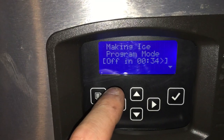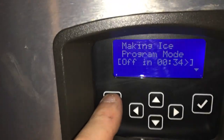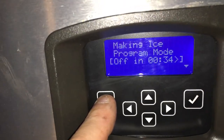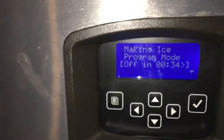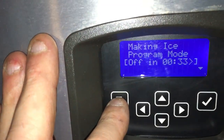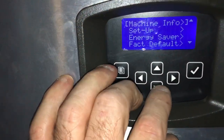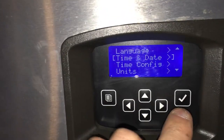What will kick you in the teeth is you have to make sure that you set the day and time in this machine. Remember, this isn't a cell phone — it's an ice machine. It's not hooked up to the internet, and it doesn't have a battery to keep the correct time. It doesn't have a CR2032 on the board, like a battery on the motherboard, to keep the time. That's what first kicked me in the teeth when doing the setup. You gotta set the time and date — super critical.